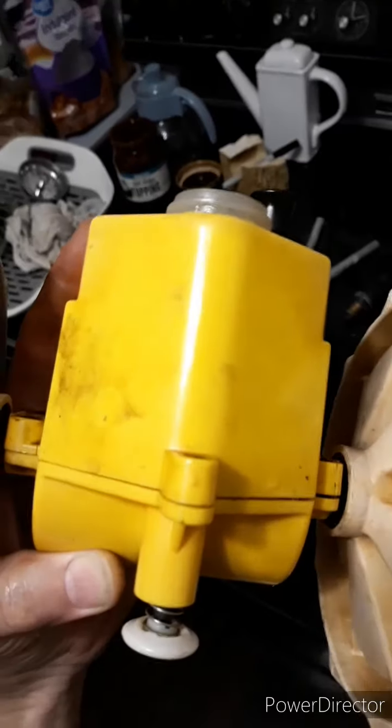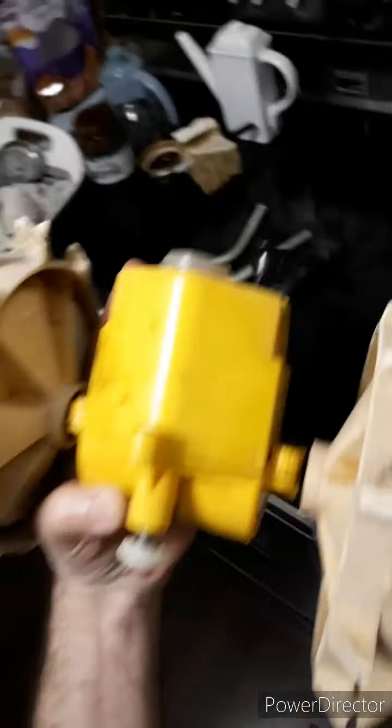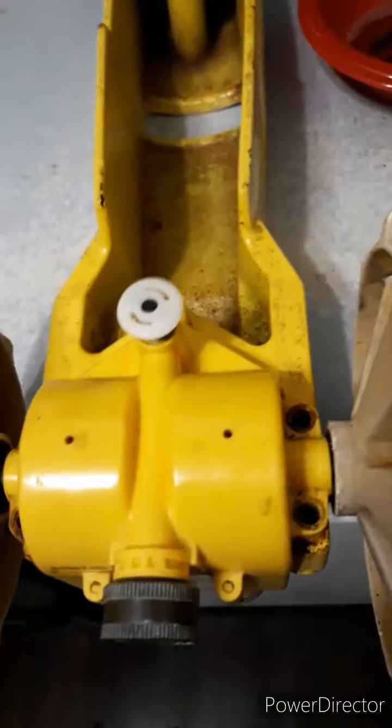Worst case scenario, we can replace this yellow block right here. I've done it before - I bought this used at a garage sale for $5 because it did not have a drive system that was working. The only thing wrong was missing teeth on the gears. I ordered it straight from Nelson and they sent this whole unit. I just replaced it and it was all good after that. Once you've got all the screws out of the body, put this unit somewhere that will hold it securely. Once it comes apart, you don't want the wheels and gears to fall out. We're going to take the main bottom part where the hose goes and just clean it out.